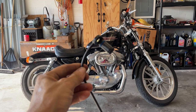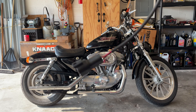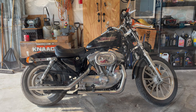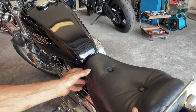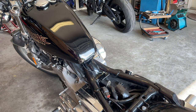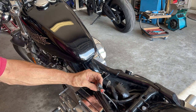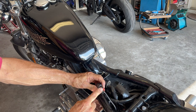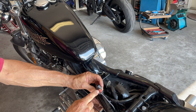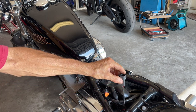This is pretty much what the sensor looks like. You have your wire clip here — what we will do is disconnect it. Now what we want to do is remove the seat. You have your little Phillips head back here. This is the plug for your speed sensor. Now take a picture of the way these wires are located and their colors. Just work it apart — this is the piece that's being removed.